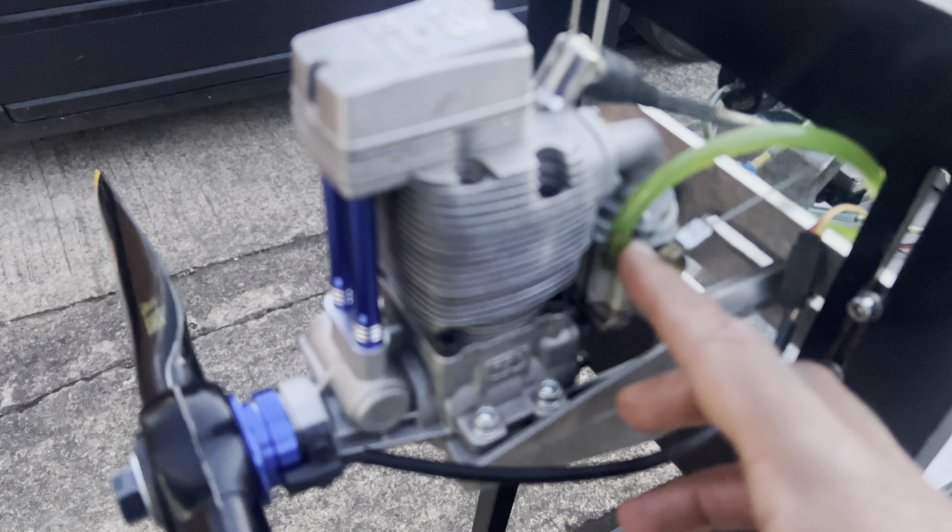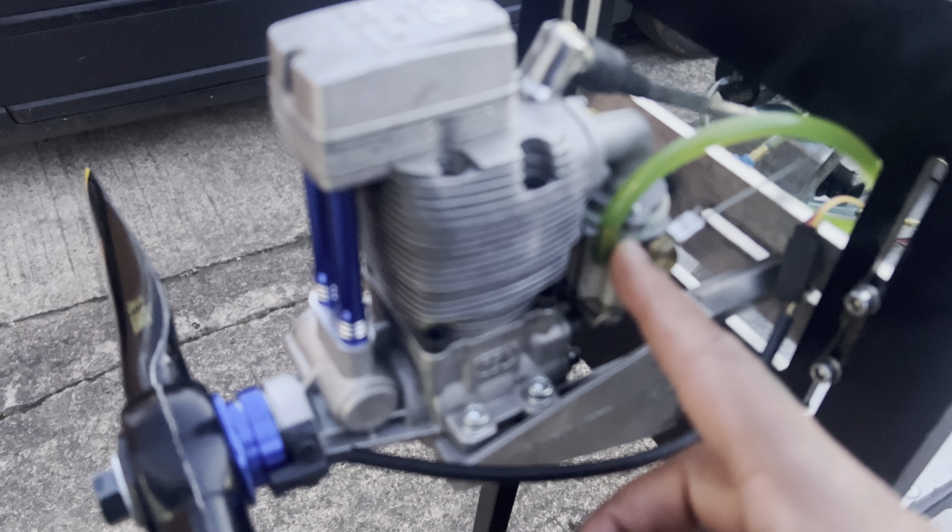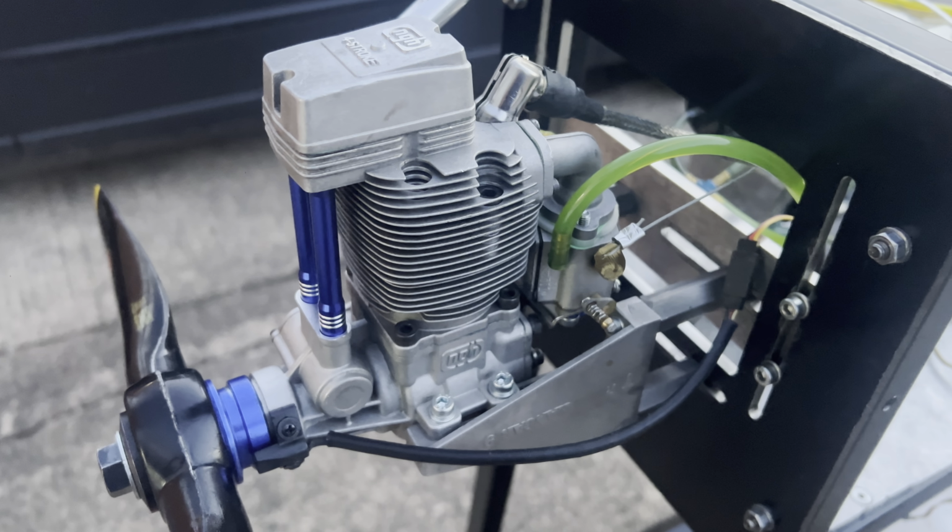We have done several NGH before, and one thing we noticed is that from the factory, between the carburetor and the carb block, they add the heat spacer, but they don't add gaskets at all. Not sure why. It also happened on the 2-strokes as well, but if you don't add paper gaskets there, definitely that would leak.